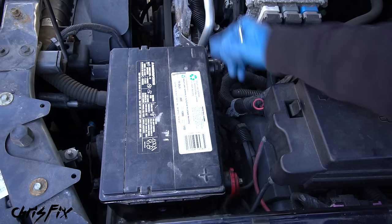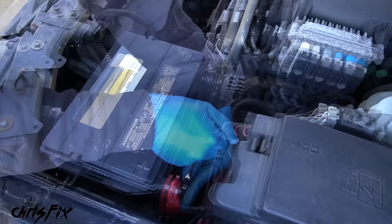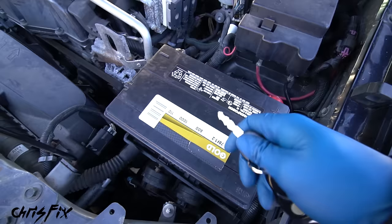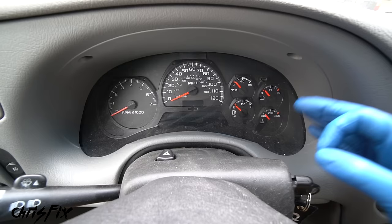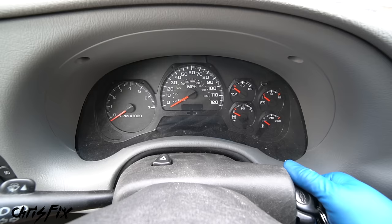The first thing we need to do is remove the old dead battery. Remove the cables, out with the old and in with the new, then tighten up each battery cable so they're snug and have a good connection. Secure the battery by tightening down the battery hold-down so it won't become a projectile in an accident. With the new battery in, let's see if we can start her up. The previous owner said it won't run because it has a bad fuel pump. We put the key in the ignition to the run position — I'm listening for a fuel pump hum — and I don't hear anything. Let's try to start it anyway. That's not good — our starter isn't functioning either.